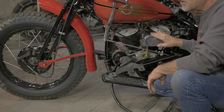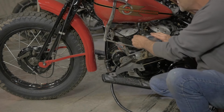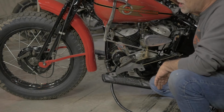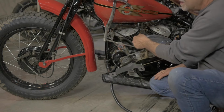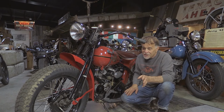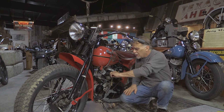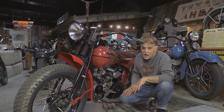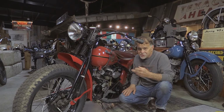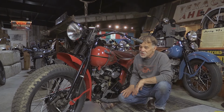This is the carburetor. The most important thing you need to understand about this carburetor is the choke. Up is on, down is where you run. Now 45s are naturally cold in nature, and even if the bike is sitting for just a few minutes, you probably ought to kick it with the choke on, without the key on at least once. Take the choke to half, turn your key on, the bike will start right up. We're going to do a cold start in just a minute.